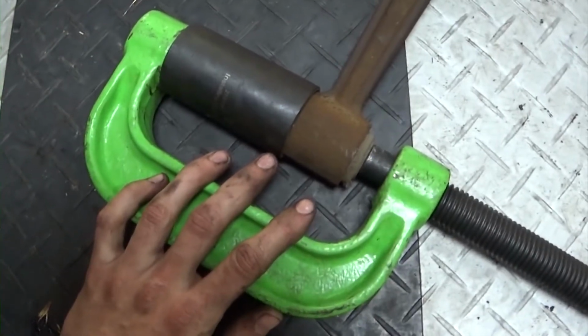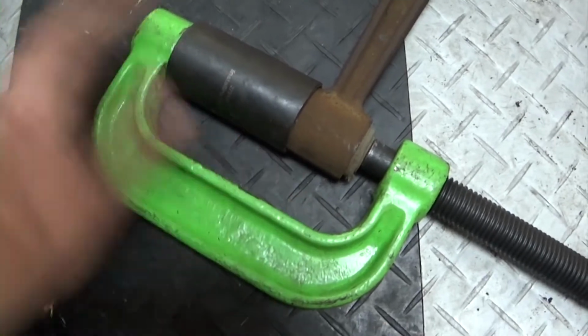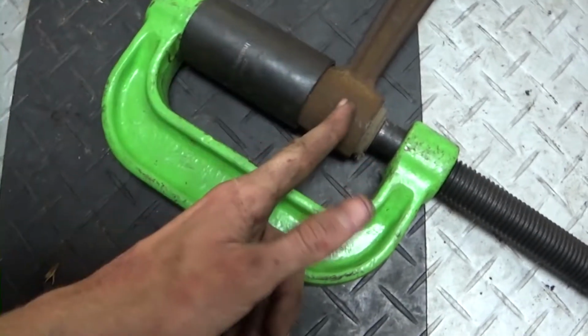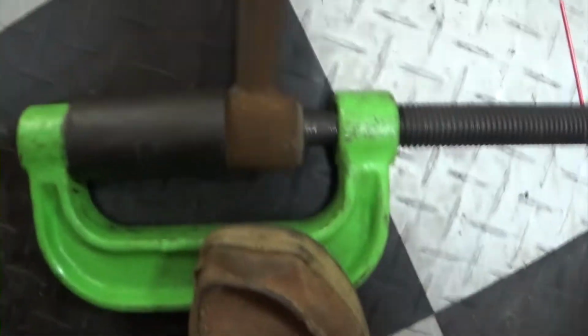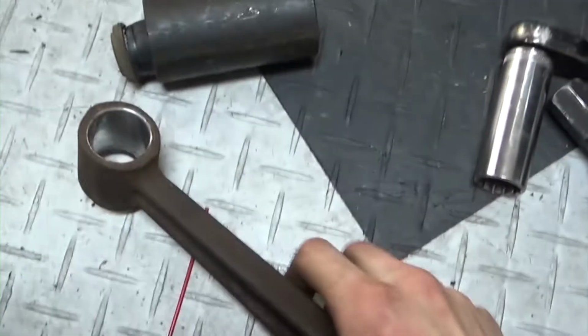All right, so once you get all your control arms out, the easiest way to press the bushing is to rent yourself one of these. They're sort of expensive. It's like $200 to rent at AutoZone, but you get all your money back when you're done. Basic gist of it, you've got your control arm with your bushing in it. You've got your press side with a 22mm socket and a 1/2-inch wrench, and then a cup to catch it. So you're gonna put your foot here and tighten this down. And now, no bushing. Ready for a new one.